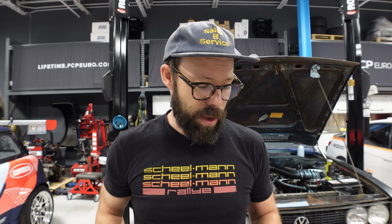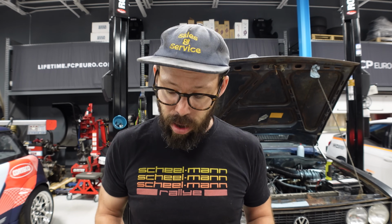All right, so a little bit of a problem. The points have given up the ghost. A really special little wire called the resistor wire died, it fried. I don't know why, but it did. And these points have been giving us a problem ever since day one in this car.